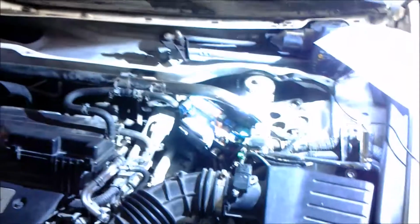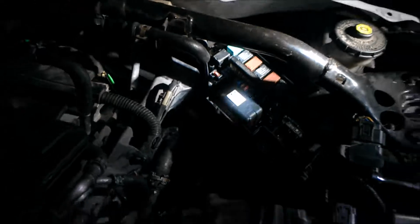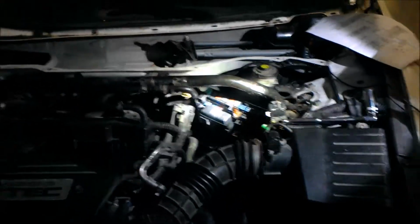Alright guys, we're going to check the fuse for the window wiper motor. And it's actually this long strip right here. And we can't check it on this vehicle. But you'd probably be able to check it with the metal right here on both sides to see if you can get voltage through it, or just use a test light. And if it's not working, replace it. If it is, then the motor should be working.